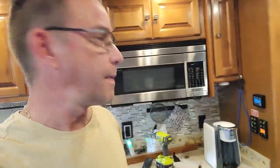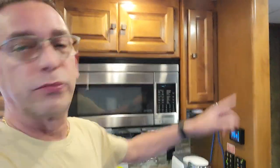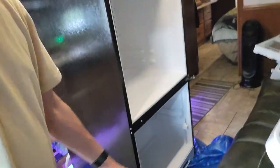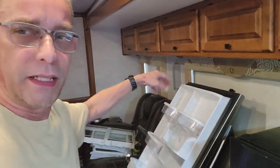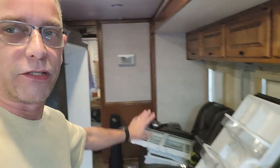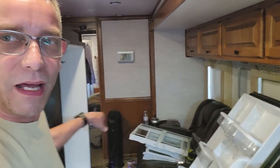We got the residential refrigerator out of our 2014 Tiffin 36LA — slid it out, me and my wife. I showed you where the screws were retaining it at the top and two through that bottom grill area on the fridge. After we got it out, I was able to clean it over, then I removed the top hinge bracket and the door slid up and off. I got all the drawers out — I should have had the glass drawers and stuff out from the get-go, I forgot about that.